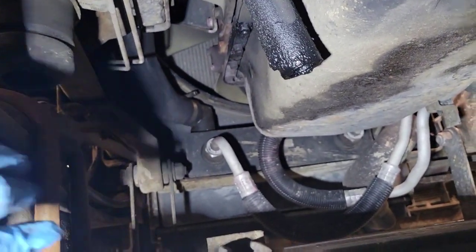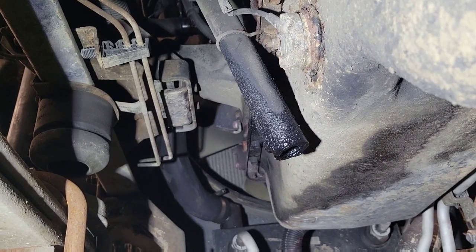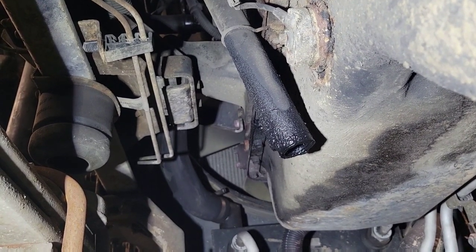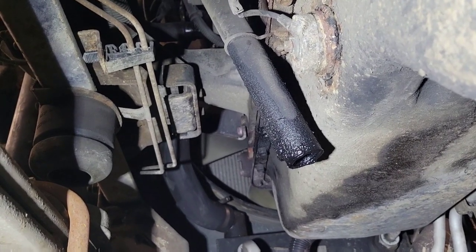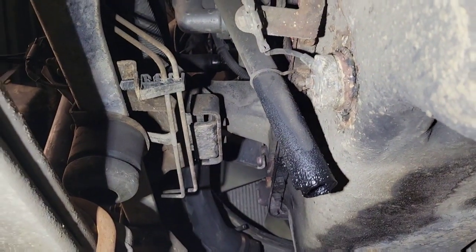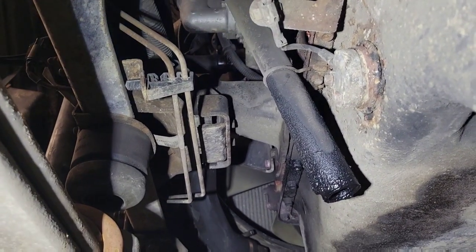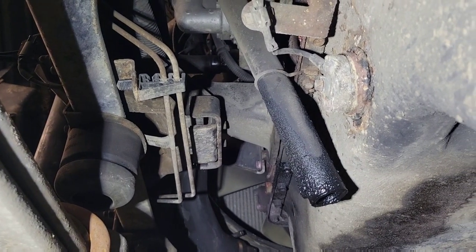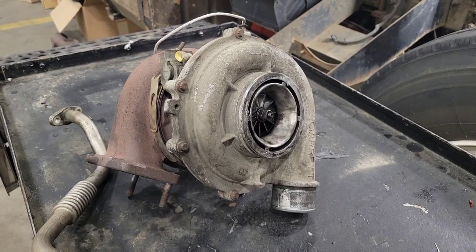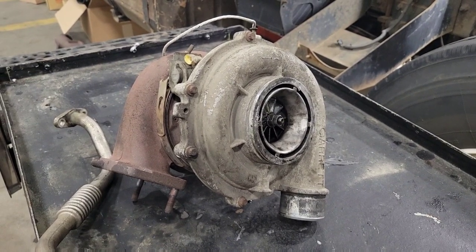It's normal to get a little bit of oil drip from that vent tube, but I've actually seen trucks come in with bolts plugged in that hole because it was dripping and they thought it was a leak. Also check that there are no kinks — someone working on the engine might have tucked that tube out of the way or zip-tied it to something, and a kink could cause your crankcase pressure to go sky high. It doesn't matter if your engine is gasoline powered or diesel — all these tips are the same and will guide you in the right direction on what's causing your oil consumption or turbo leak.